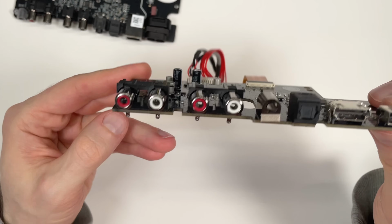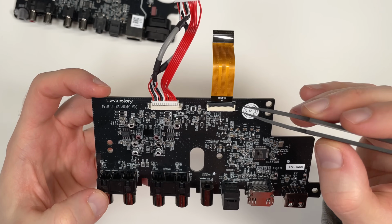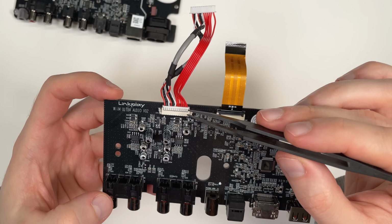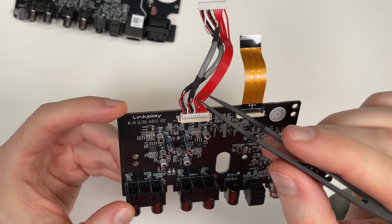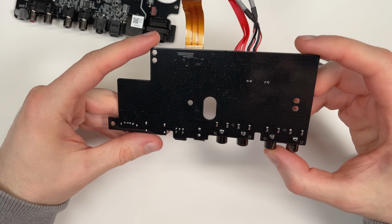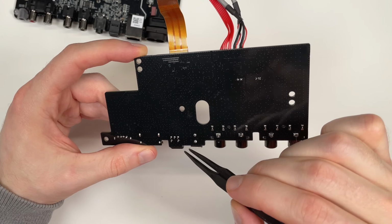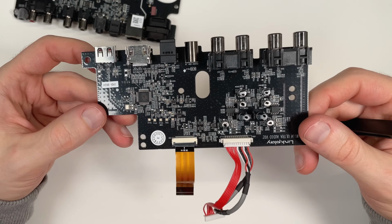And this is the phono ground banana jack here. So of these connectors going to the main board, looks like this is the digital high-speed signals and this is analog and proper power. These two are probably the phono input and the line input. And there's nothing on the bottom side of this board, just some traces. It seems that the ground plane is split here. I guess analog and digital. Usually it's not something you should do, but it's probably fine here.